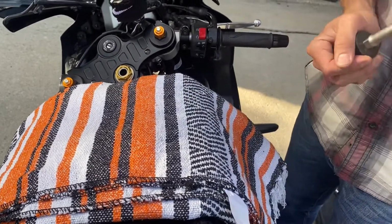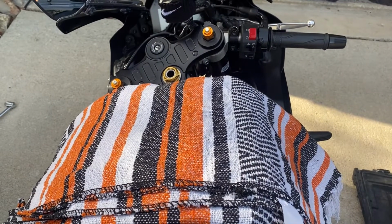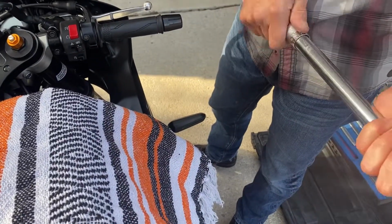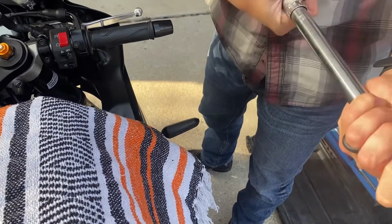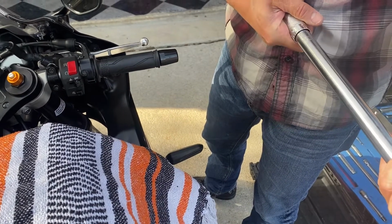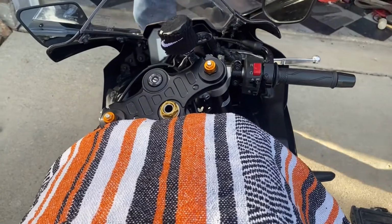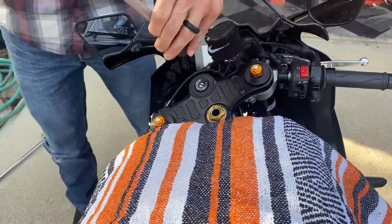All right, get it snug. And this particular nut has a spec on it of 85 foot-pounds. So let's get 85 foot-pounds on the torque wrench. 85 sitting right around in here, so let's dial that in. All right, we're hitting 80, and then 5 is right here. We're gonna lock it in. Okay, so with torque wrenches, you want to pull the wrench towards you. That way you don't over tighten. So we're going to stand like this.